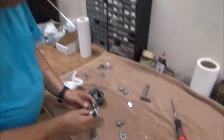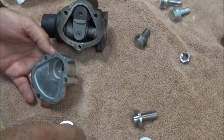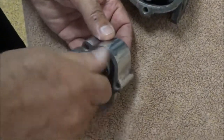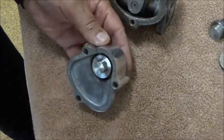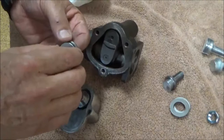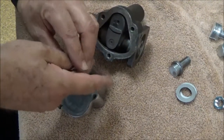The repair of the Tompkins kit is very easy — it's a remove and replace type item. First, remove the cover itself and unscrew the existing Tompkins adjust screw which has the larger washers. Set those aside and then simply screw in the new adjust screw. In order to get everything set up correctly, we've got the smaller thrust washers and needle bearing. You want to pre-lube this because it's not like this stuff splashes — it's really thick molasses. You can just dunk your finger in there and pre-lube this very liberally on both sides.